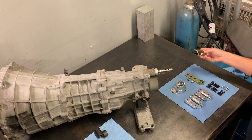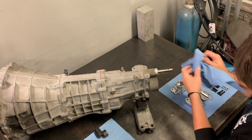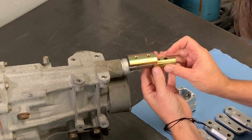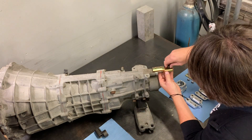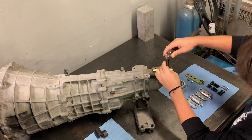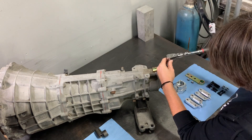The first step on assembly is to take the shifter sleeve and slide it onto the back of the transmission. Before you slide it on, take a rag and clean the surface to make sure it's really clean. This is a precision fit but should slide on pretty easily. You're going to align the hole and reuse the bolt from the original shifter sleeve to align the shaft so that you can press the roll pin in.